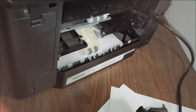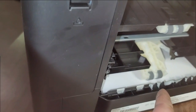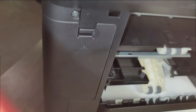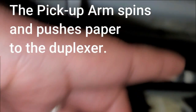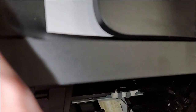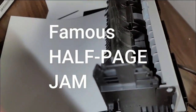I'll show you a quick view of what's going on without the duplexer — you can see how the gear here, the pickup, does it twice — and then I'll do it with the duplexer. You can see for the first one it picks, then it kind of pushes — too much push. Now you can hear that there's spinning for nothing. I'll show you what happens with the duplexer. See, something is trying to pull but it's not taking anything. And if I take out the duplexer, it's always at this level.